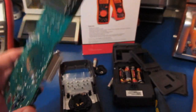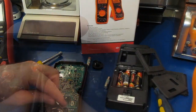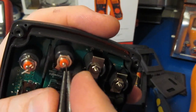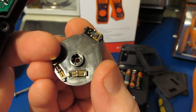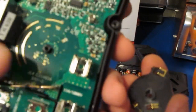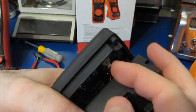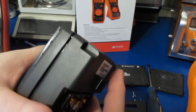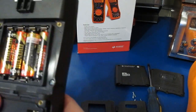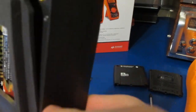You'll notice the nuts have a rounded side and a flat side — the flat side goes down. We just loop the little springs back over the top of the notch and pull them back into place. The top wafer is keyed — notice the three knobs towards the bottom and the lack of them on one side, so it only goes on one way. We just plug in our power cable. They gave you basically no lead there, so be careful if you take yours apart.